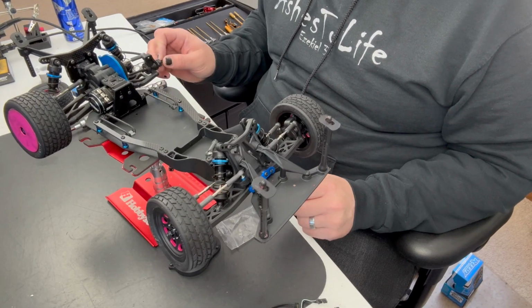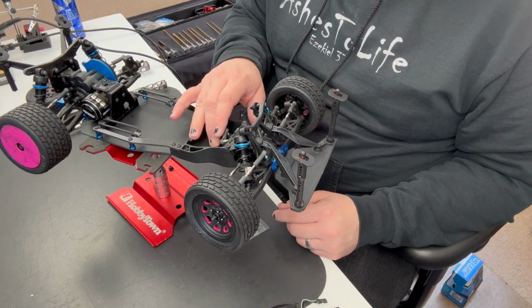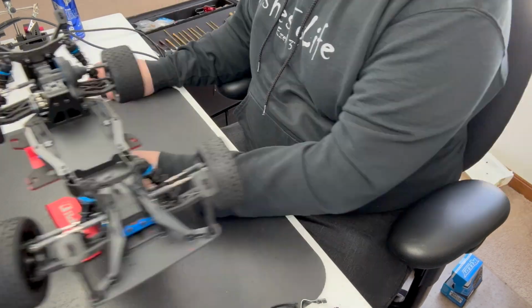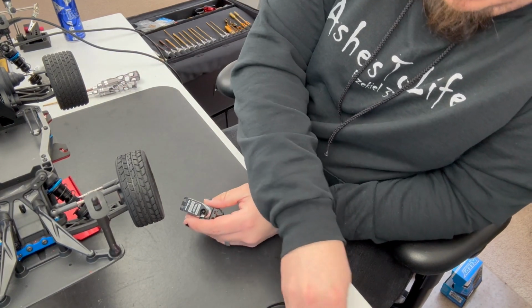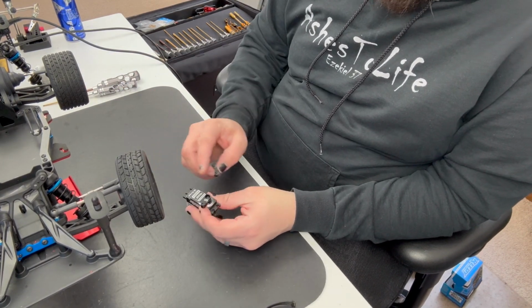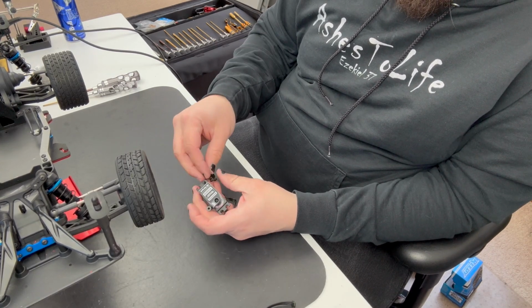Let's go ahead and put that cover back on and our rear wheel on, and then we'll do our steering servo and then our speed controller soldering. So go ahead and slide that aside for right now. First things first is we need to get our servo mounts on. Like usual, the servo horn faces up, not down like I accidentally started to do in the A-Mod.